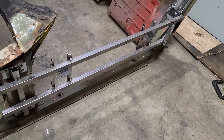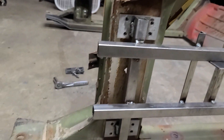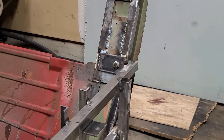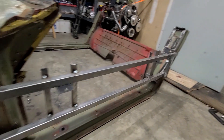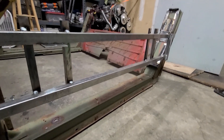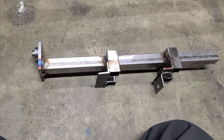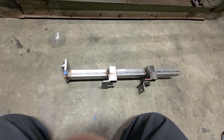This is what it looks like — it plugs into the existing holes up there and back here, and it bolts with the striker bolt in there to secure the lock pillar to this jig. I don't have the center alignment parts in right now — I'll show you that in a minute, they basically just plug in. So here's one of the removable pieces of my jig.